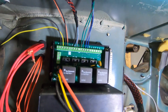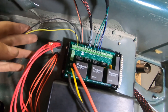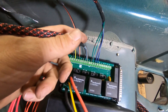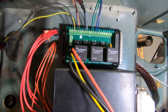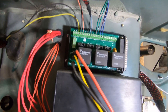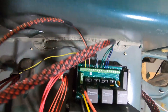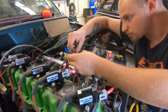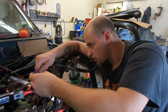We've connected a couple of our wires in here. We've got our water temperature, intake air temperature, throttle position sensor, and idle air control all wired in. Very simple, very straightforward — it's all in the Mega Squirt manual with every wire color listed. Jeff's still over here working on the coils; it's a little tricky but it looks like he's got it figured out. Slow process, but we're getting there. I've wired as much as I can inside here.